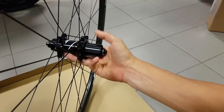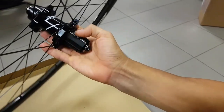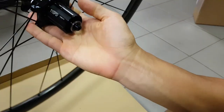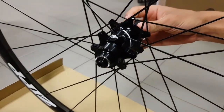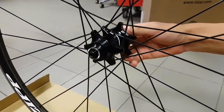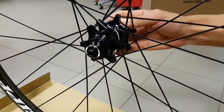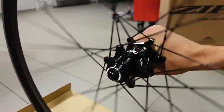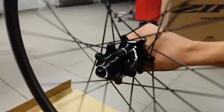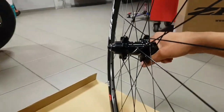My cyclocross wheels are going to have the same hub, so I'm happy about that — not too noisy either. The free hub body itself appears to be made of quite a hard alloy, and they lack the preload adjustment, which I think is great because you have a factory set preload and you don't need to worry too much about it. In my previous 303s the preload was quite tricky to adjust in the rear: if you tighten it really hard you don't have any play but the bearings aren't running overly smooth, and if you loosen it up you always have a little bit of play. But these are super smooth with no play, so should work like a treat.